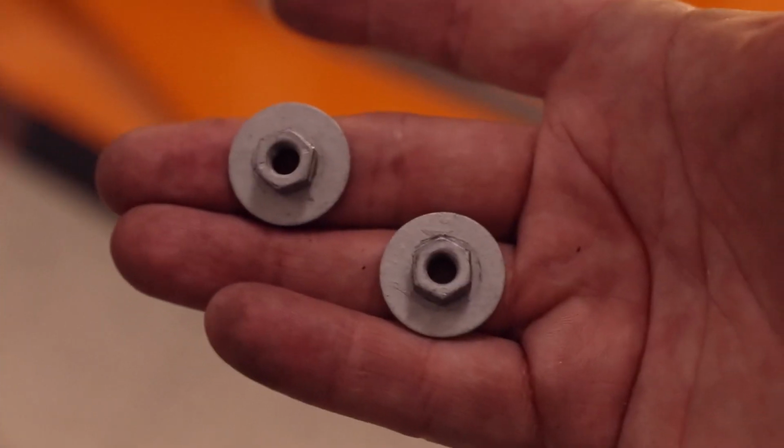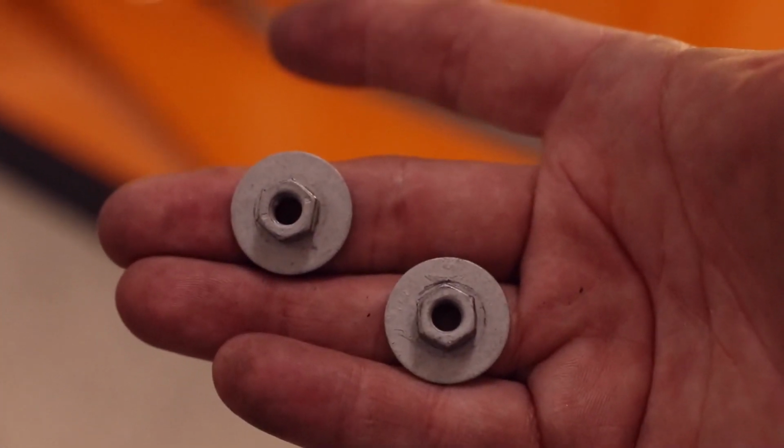Okay, so now there's 2 bolts up inside of these fender wells here that have to come out, and they're both 10mm. So I've got my ratchet on one of them already. I'm just going to break them both loose. And then I should be able to reach in there by hand and get them out the rest of the way. So with these two bolts removed, I'm going to move on to the next side.